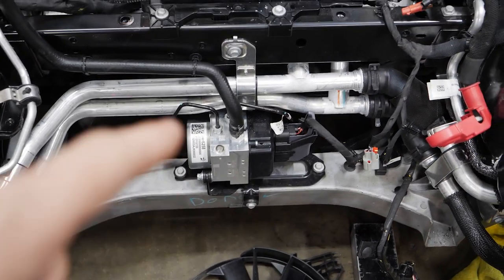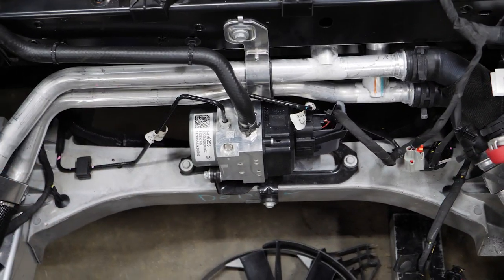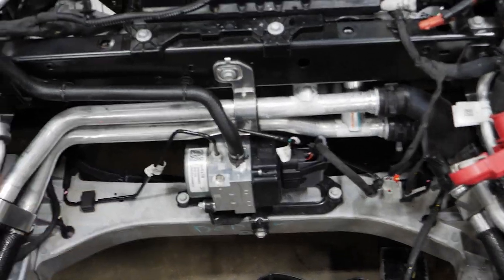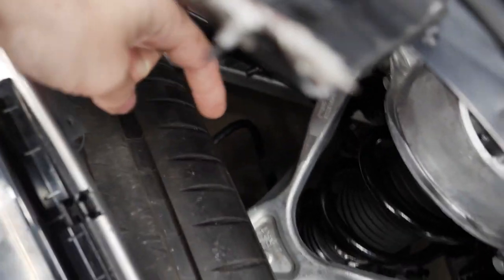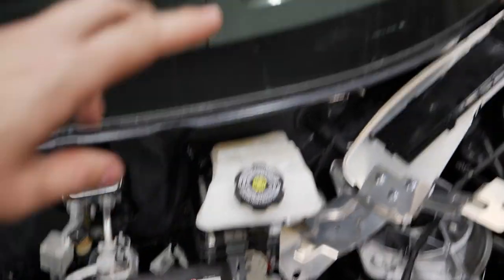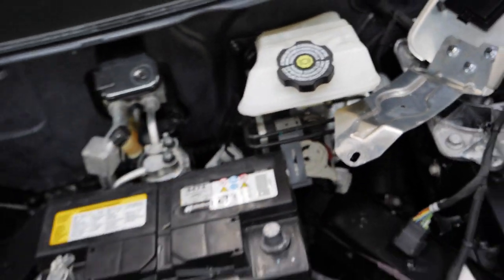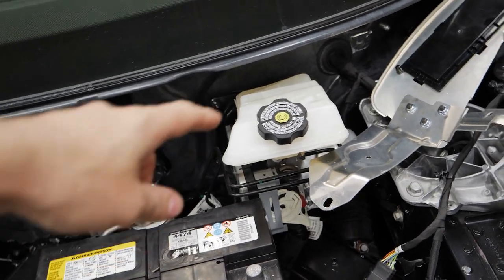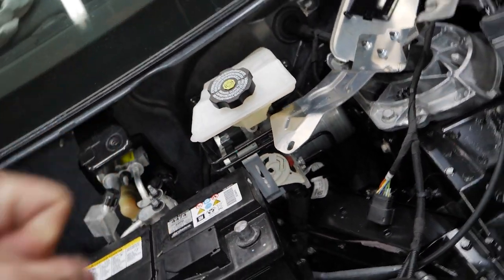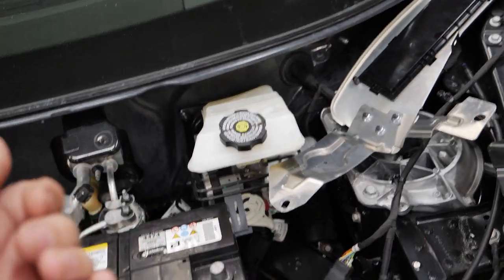I can't be more appreciative of the sound cutout because I was dead wrong about that box right there. I assumed it was a brake system — there are two brake lines and a brake fluid canister, both hard lines for high pressure. That is not the case. That is actually the optional lift, sitting right there in the middle. That line runs all the way back and actually plugs into the very bottom of the shock. The brake system on this car is more like Forza. That car does not have a real pedal — the pedal does not get actuated by fluid. There's no master-slave cylinder in that sense. There is a reservoir and ABS, but that right there actually pressurizes the brakes for you. So it is similar to drive-by-wire — this is brake-by-wire. That means the pedal has to be operational inside of this system or this car will not work for me.